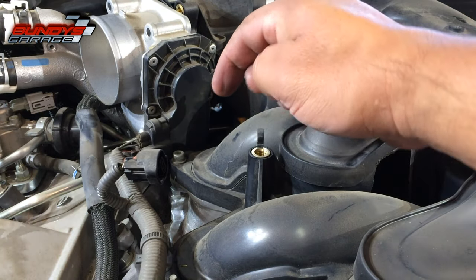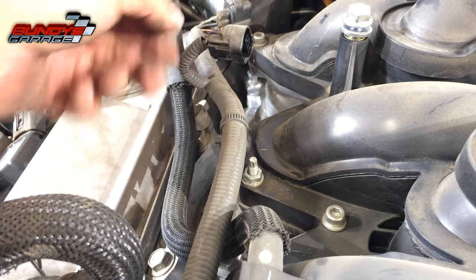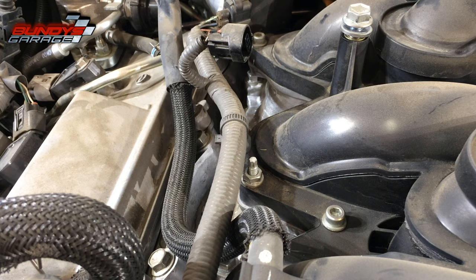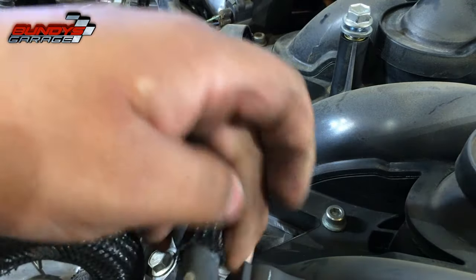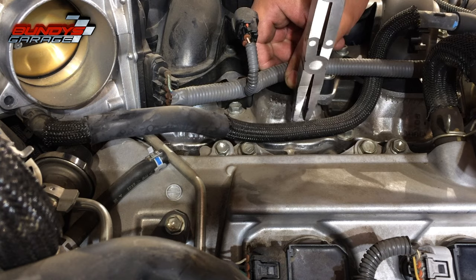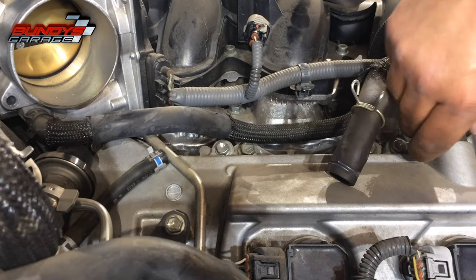Laying the wiring harness out to the side, putting this back so I know where it goes. This connection right here was super easy — just pulled the hose right out, no clamps. This is the wire harness for the throttle body; it has two connections that are part of the plenum. I'll pop those loose from beneath — just squeeze them together to get them free so I can get the intake off. There's also a coolant hose going to the throttle body with two little clips that you squeeze together to get it up and out.